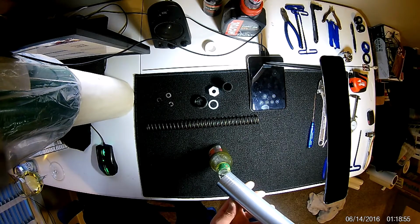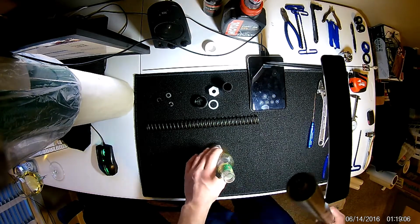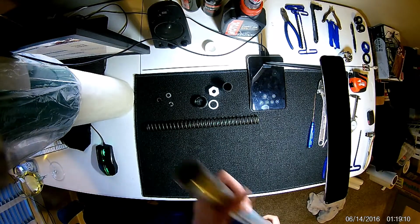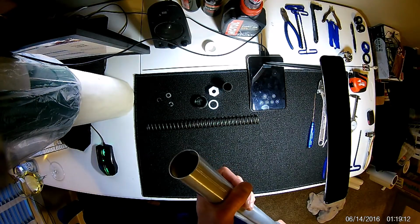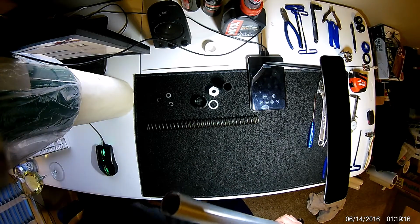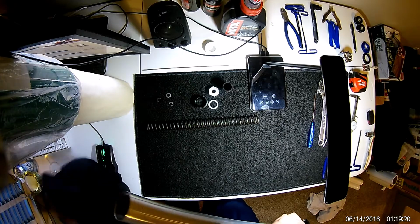Another thing to note, your cartridge will be filled with some oil. So as you go through this process, it's kind of never-ending oil because that cartridge will always be leaking some. Although you obviously don't need to get it all out, it's just fork oil, you want to get as much out as you can so when your fresh oil goes in, it's nice and clean.